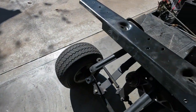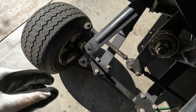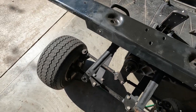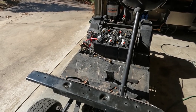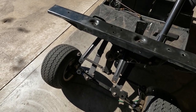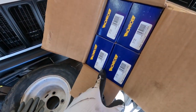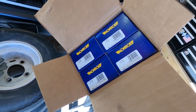The reason I had to use these is because with this lift kit, my old factory shocks — even the new ones I ordered made for the golf cart — they were a little short. I was going to have to compress the front end down to get them to bolt up. The rear was the same way — I was going to have to compress them down about an inch. It probably would have worked, but I don't want that shock holding all that compression. A few guys online recommended this Monroe for their EZ-GO and some Club Cars, and they say they work fine, so we're about to find out.